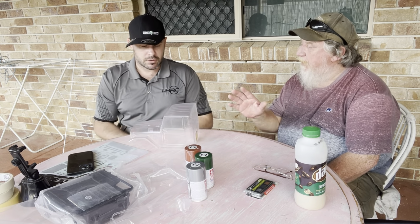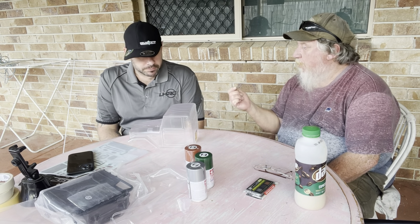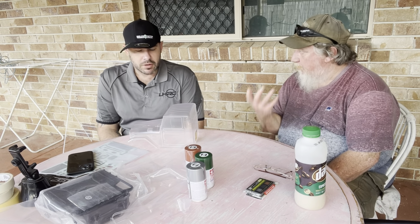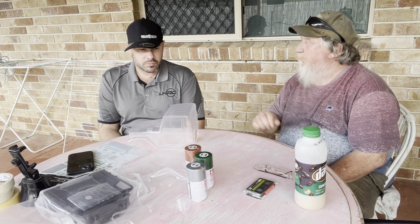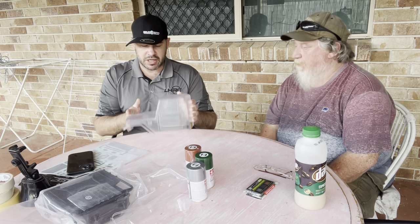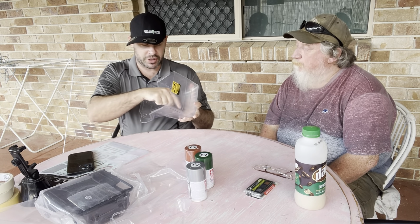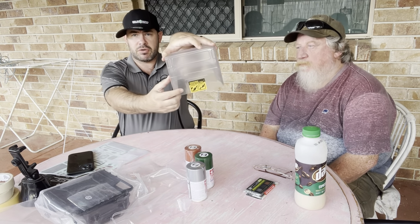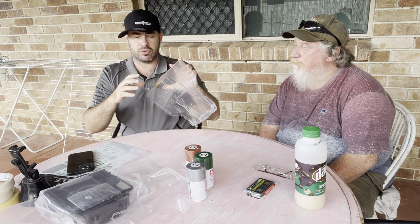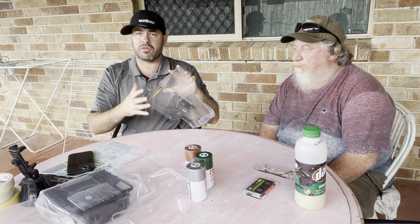Now, normally with a Lexan body, the reason for the outside plastic coating is usually a normal paint job. You're painting the inside. That's correct, yeah. And then you're peeling the plastic off at the very end, leaving yourself that beautiful glossy shine. That's it, and then you get your showroom finish. So with Lexans, you use your window masks on the inside, you paint on the inside, and your protective film, as you can see the sticker on the back there, is just to remind you to protect the outside body from overspray.